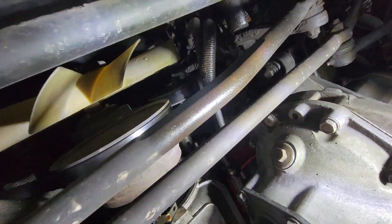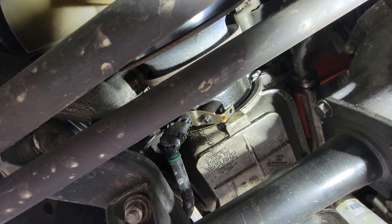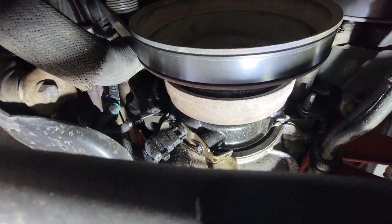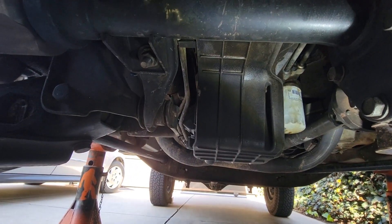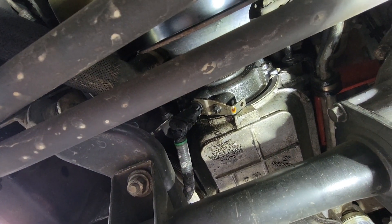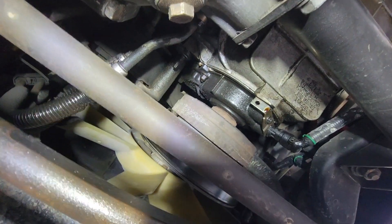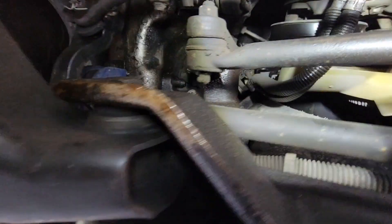I'll try to get some light on this for you. You can see up in here - it's a little bit wet. There's a little drip of oil right there on the crankshaft position sensor, and the whole front of that timing cover. I have another one in a box. There's a little wetness and you can see it's been hitting the oil pan - a little bit of blowback. It's not the end of the world. It never registers on the dipstick, so it's not like I'm losing oil really - it's just a slight weep. When you're driving, the air forces it back. But to get to that you've got to pull the balance wheel and everything else off - it's a hassle.